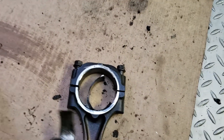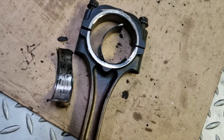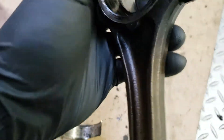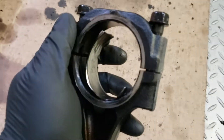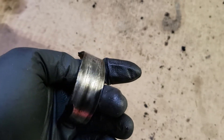So it looked like it had a cylinder number four spun bearing. I want to show you some of these pieces here. Overall the bearings on the mains were all good — it's mainly cylinder number four that was the issue. It was kind of a pain for them to disassemble at the shop; they had to really tear it out.